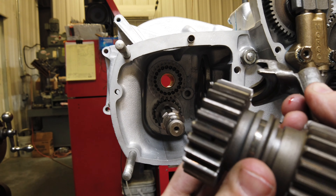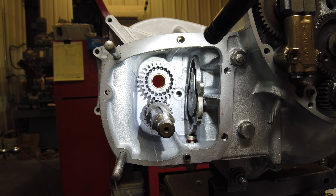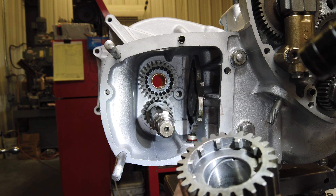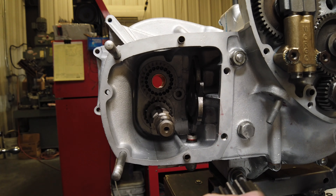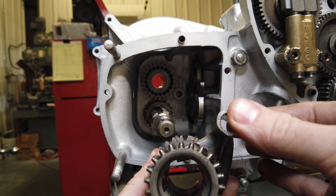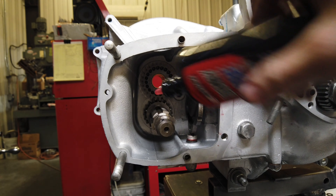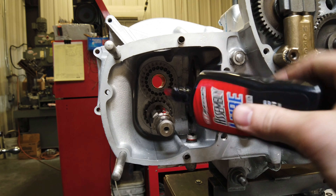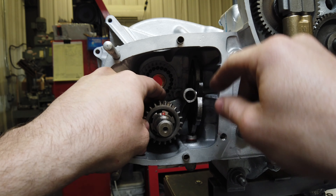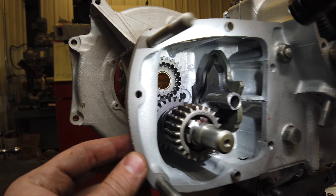Here is second and third, and that's how the lay shaft rides on it. Fourth gear on the lay shaft — or high gear — has dogs, and second gear has dog houses. Those are what you want to engage, so that's how you know what direction these need to go in when you're reassembling it. You've got your shift fork on with the little roller. Put a bunch of assembly lube on the lay shaft — you can never have too much — and then slide it right on. Your shift fork is going to land in the cam plate just like that.